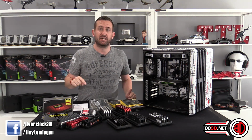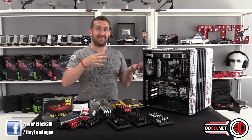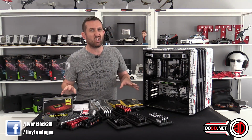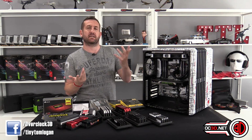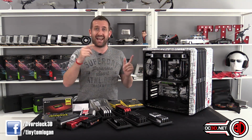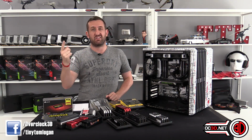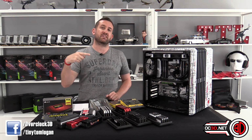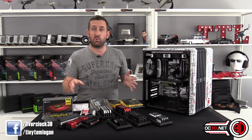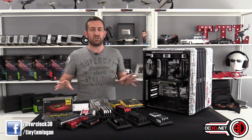But because I've got other kits, I then tried some faster memory. Now normally if you put a faster memory kit in, for argument's sake 3600 megahertz, as I have done with the other X99 boards, you can't run XMP, and that's unsurprising. 3600 megahertz is a bit too much of an ask. But what you can do is put it in, enable XMP, and then where it says speed 3600 megahertz, you can start to knock it back. So you go 3466, 3400, 3333, and you can work your way back, and you can find a point with the 100 base clock that it will post on the XMP setting, despite the fact that you've changed the bandwidth of it.